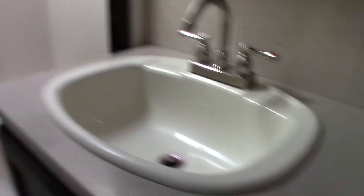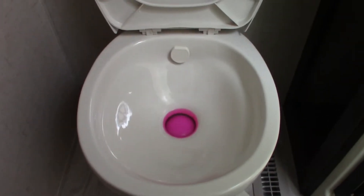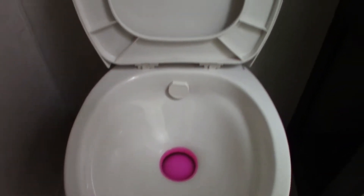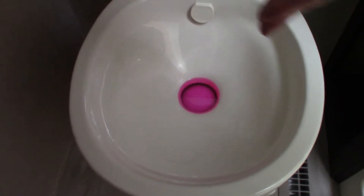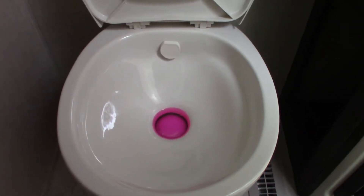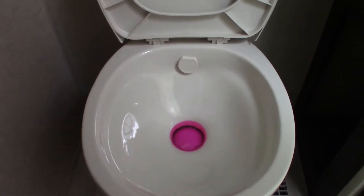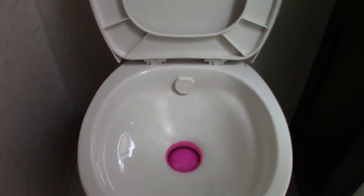You also have a power vent here. Your shower and sink work like any other shower and sink. Now the toilet — right now that's antifreeze in it, and there's the flush pedal. When you get to the campground and hook up your power and water, the black tank is directly below the toilet. Put one dose of chemical in the bowl, then step on the pedal and hold it down until about a gallon of water goes into the black tank along with the chemical. You can use more than a gallon if you want, but at least a gallon. You can't use it dry because the smell will be terrible and it can get clogged — always have chemical and water in it before you use it. Do that with both toilets since each has its own black tank.